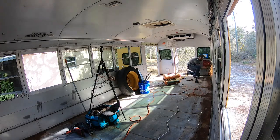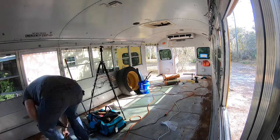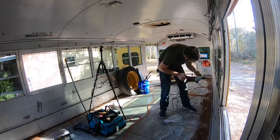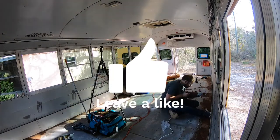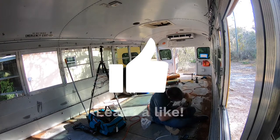It is a little bit more energy, but it's going pretty quick. On the lower side panels where there are aluminum rivets, I've actually taken the big drill that we used to get the track out of the floor, put in a different drill bit, and have been drilling those out. That's been working really well on the aluminum ones. But for the bigger steel ones in the ceiling and some of the side panels, those really need to be popped with the air hammer and then come back in with a chisel and a hammer and just whack them until they snap. So let's get to it and finish getting out the side panels and the rest of the ceiling.